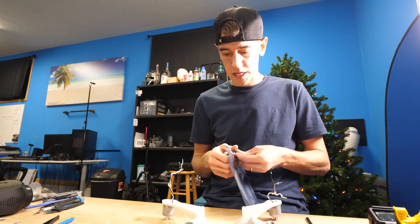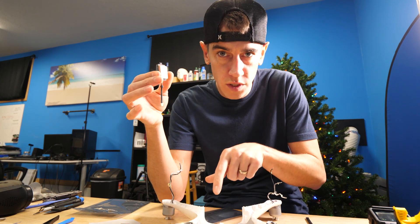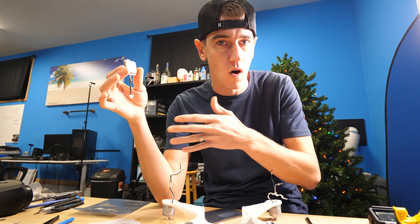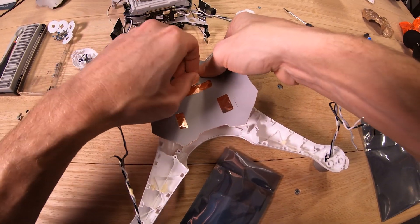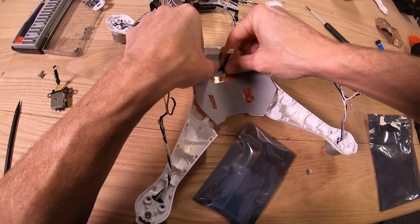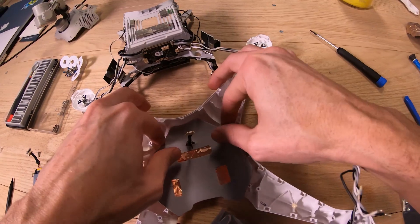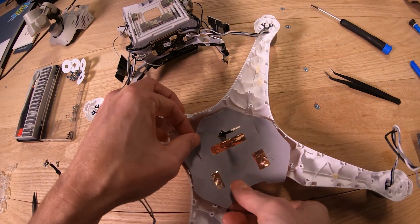I have a brand new GPS module. We'll peel back the shield, take off the old GPS module, replace the new shield, and then start the process of putting it back together — that's all pretty much the reverse of what we've just done. The GPS unit itself is pretty self-explanatory: there are just three screws, take those apart, and swap out the module. Replacing the shield is a little tricky because it's very sticky. There are cutouts to help you line it up — make sure everything's snug up against there, and start putting it back together in reverse order.